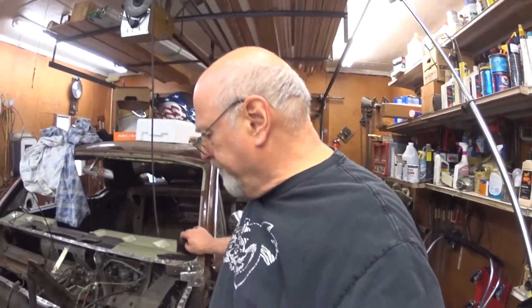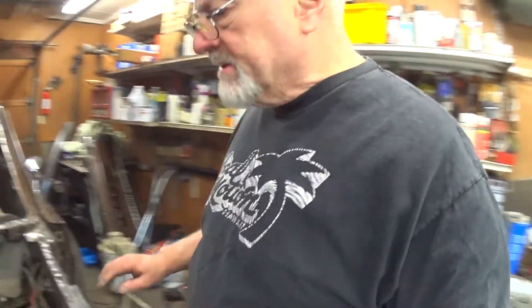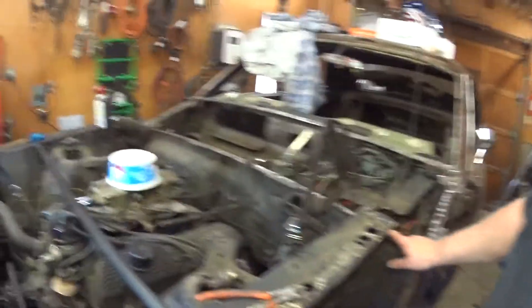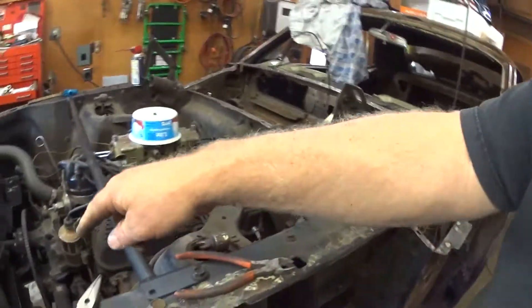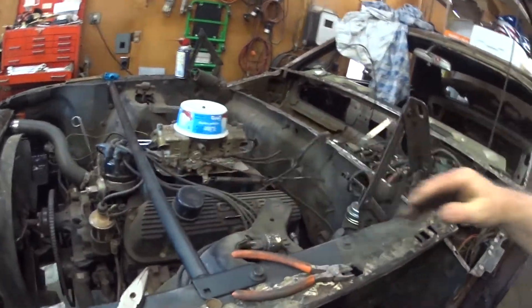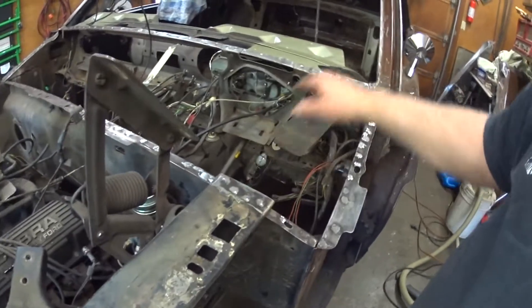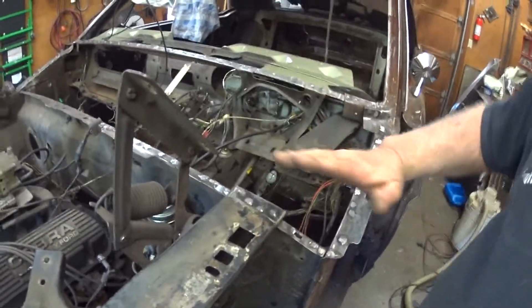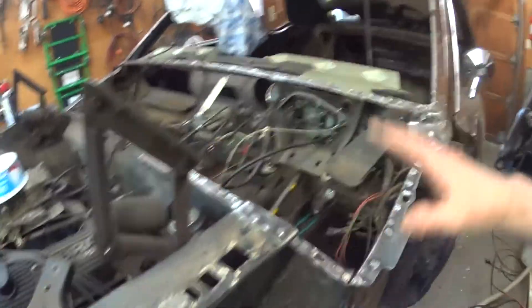Checking a few things — I've got the frame up on jack stands now. I realized how much things are moving. The distance from jacking up the front end until it picks up the weight, then letting the front end hang on the jack stands, changes by three-eighths of an inch. So the nose dives three-eighths of an inch and it bends the cowl.